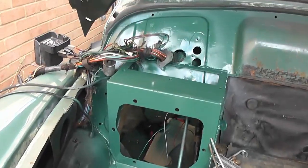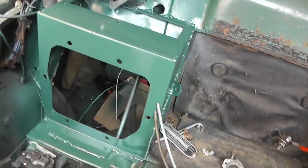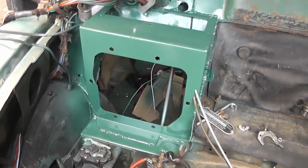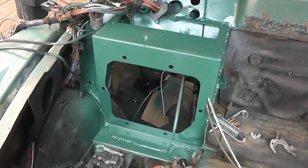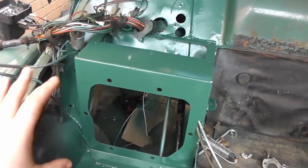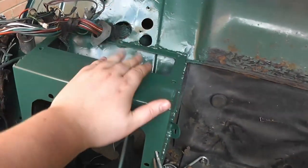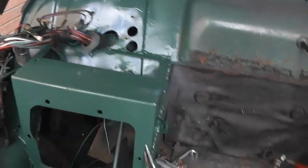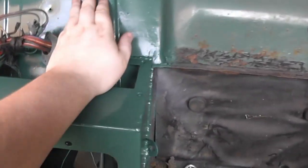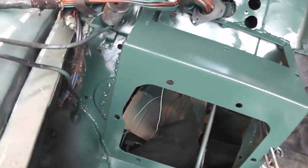And there we go, it's done. I didn't film any of the subsequent painting of the bracket, because I'm sure you can imagine what someone haphazardly spraying aerosols of paint all over the place looks like, but it was all coated in the grey primer on the bare welds, and then after that had dried properly, coated in a new layer of almond green paint, and then on top of that a layer of lacquer. The layer of lacquer may be a bit overkill and it's probably gone a bit too shiny up here, but it will at least protect it all nicely.